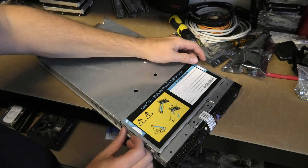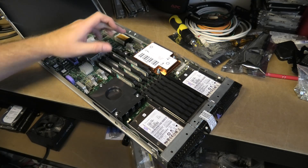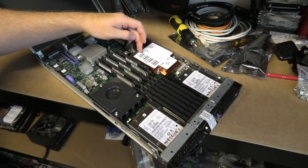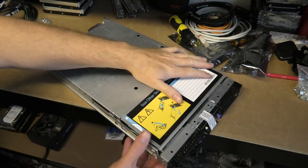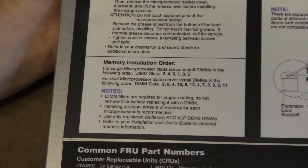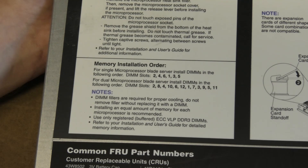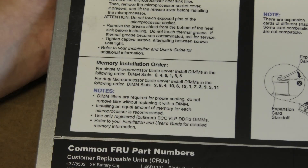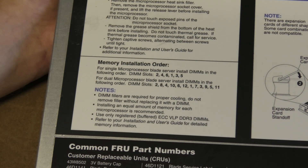Just to look at something more exotic at the end, this is RAM in a blade server — there are just three RAM blocks in here, but there is a drawing of which DIMM is which DIMM. There are 12 DIMMs in this one. To see how to put those DIMMs in, you go to the back of the blade server, and they have an explanation where they very simply tell you which order the DIMMs go in for one or two CPUs. It becomes complicated if you want to mix memory sizes, because in that case you need to pair them up and go see the documentation.